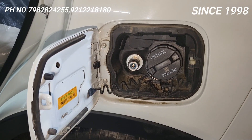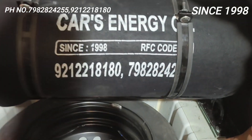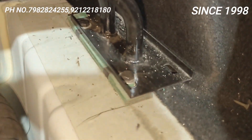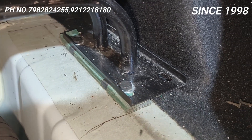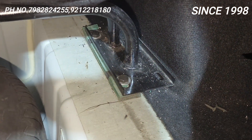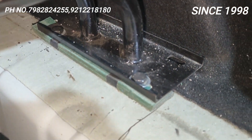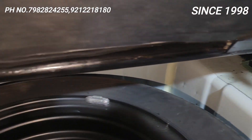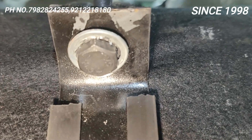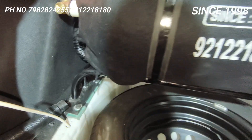Inside, we have fitted a 12 kg cylinder. Now let me show you the quality of the stand. We have made the stand on a broader sheet. Many people ask whether the cylinder's weight will crack the car body — the main reason for using a broader sheet is to prevent the right-side body from cracking. Our stand is a molded pipe stand. The nut bolts are TVS nylon lock nuts — normally after some time regular nut bolts loosen after 2, 4, or 6 months, but these will last the full life of the car. The stand also has a rubber grip.